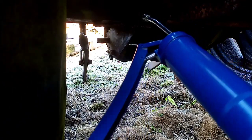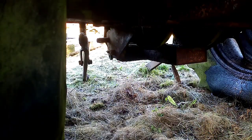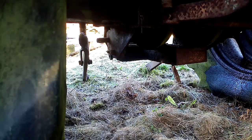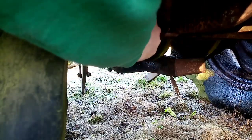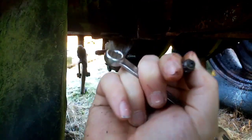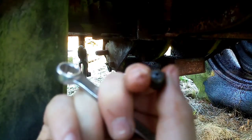As you can see there, it didn't want to pump and I wasn't going to force it. I tried to take the grease nipple off and clean it, but after I cleaned it and put it back in it still hadn't freed itself out. So in future, I'm going to get a box of grease nipples — obviously there are different sizes — and replace the ones on the tractor that need it. This one's included. It was all dirty and completely seized, so I'm just going to get a new one. They're very cheap, so it's well worth replacing.